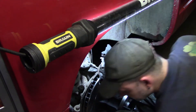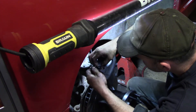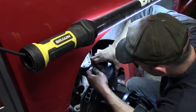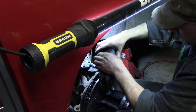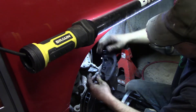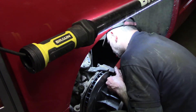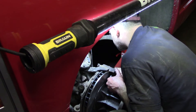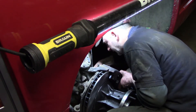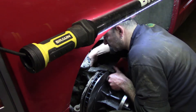Reinstall your brake pads, making sure to do that properly — put them on exactly how they came out. I do see on the internet people mess this up; make sure it's clipped in where it's supposed to be clipped in, exactly how you took it apart. Then put your caliper bolts back in so your caliper isn't flopping around — make sure you secure that properly.